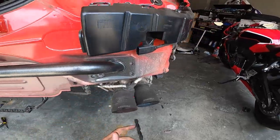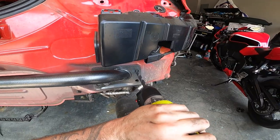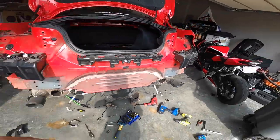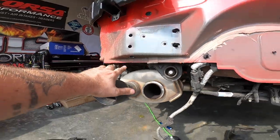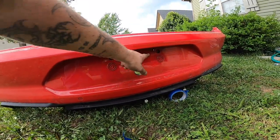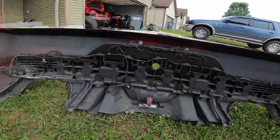Pilot holes are drilled and we're going to follow through with a half inch. Remember, first layer on this one. Now we're going all the way through — there's nothing back here, so we're just going to go all the way through. Still be very careful. Progress. We got our holes drilled out and it looks good. Cool thing about this is we can actually get by without dropping the full mufflers back here. You want to come under here and drill a hole because you're going to slide a little bracket to go on the other side. As far as the bumper goes, you find your center line for your screws to hold the license plate, come down four inches if you want it in this position, then cut a hole. Pretty simple. Use painters tape to not mess up the paint.